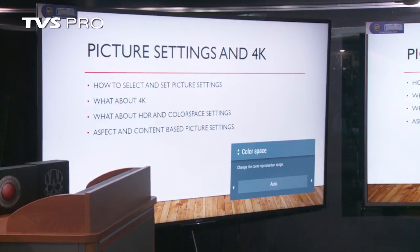Here are the color spaces. This set is set to automatic, so whatever input you give it — whether from a Blu-ray, a satellite box, or a Comcast box — it's going to determine the best color space for that content. But if you're inputting a nice 4K signal with HDR and the picture doesn't look quite right, you may want to try changing to a different color space. The BT-709 is basically for high definition and standard video. But if you get into some 4K content, you're going to want to try BT-2020, which has a much higher color saturation level and a much higher brightness requirement — I believe the standard is 1000 nits, but a lot of TVs will only do around 800. For now, I'll just leave this one in auto so it'll figure out whatever we give it.